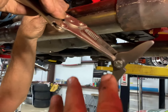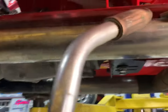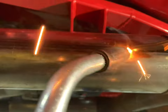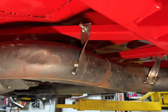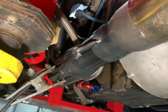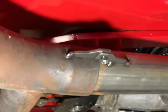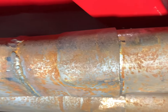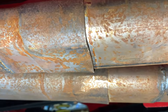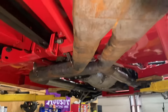I like using these tabs — I've got some extras left over from other projects. We're going to put these wherever there's a slip joint so it won't be an issue. You can see we have the hangers just tacked on, with our tabs welded on the header onto the collector — same thing on the other side, looks real nice. We have to put two more tabs on back here on that side for the slip-on tabs, then we'll make a hanging tab up here and that'll have it. Looks pretty sweet.